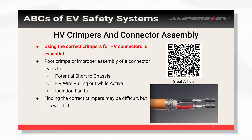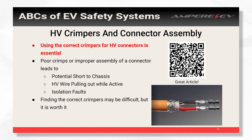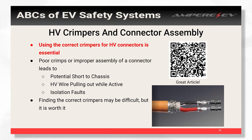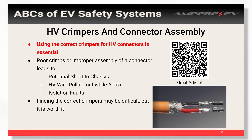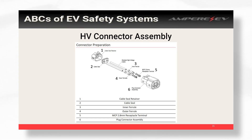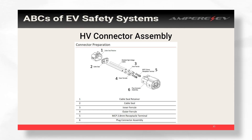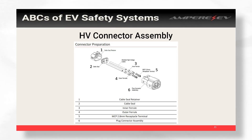One of the big things we see is crimping. You can get away with a bad crimp for low voltage, but the stakes are higher for high voltage. If you're not using the right tool to crimp terminals on high voltage connectors, you can cause a short to chassis — and this could happen while active. We spend a lot of time making sure we have the right crimpers, and it is a process. There are a lot of parts that go into one connector, and you have to do that multiple times for all your components. It's very easy for one to not be right, and that's all it takes for either your vehicle not to work or for there to be a pending problem.